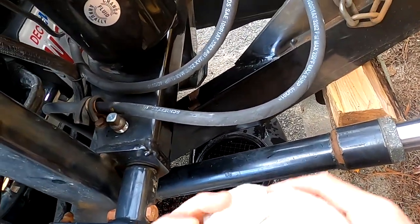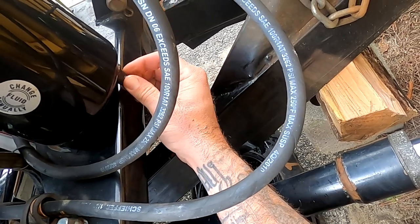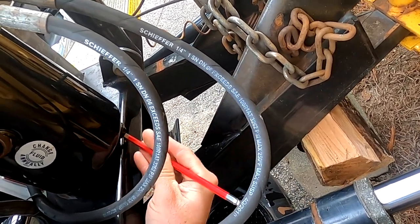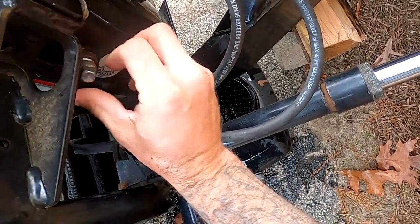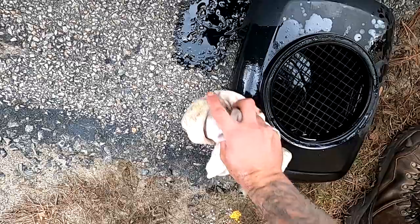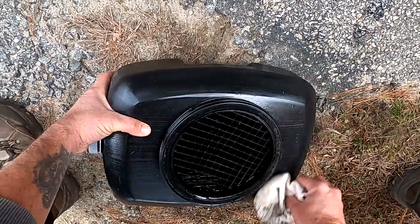It's dripping a little bit but that's pretty much all that's going to come out of there. We're going to take our drain plug and put it back in, hand tight for now. The fill plug can go in hand tight as well — that prevents any dust or anything from getting in there while you're working, keeping it all sealed up. Benny, can you grab the speedy dry from the shed?